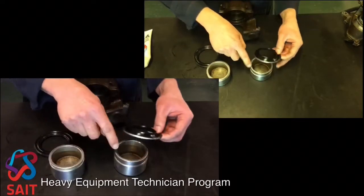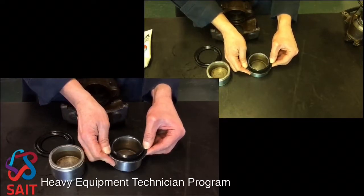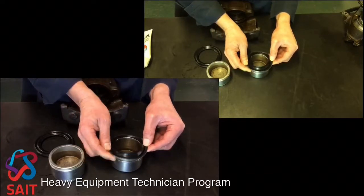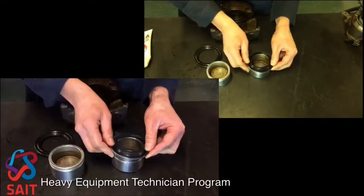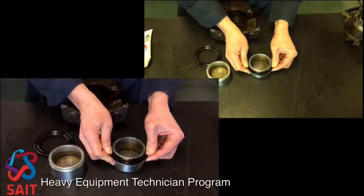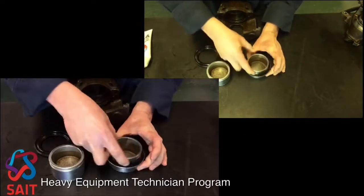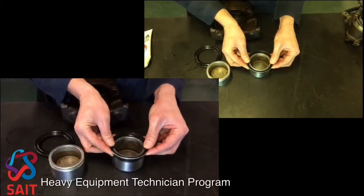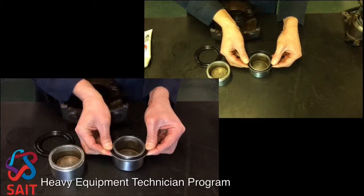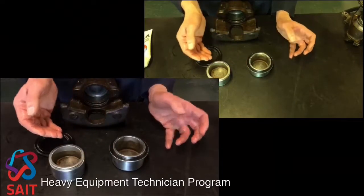When you're going to install this one, you're going to slide it down over here to start the process and make sure that the lip drops into this groove right here. I'll slide it down in there until it just drops in all the way around. Once that's dropped in, you pull this boot back — this pressed-in one — back like that, and roll it down on itself. At that point we'd be ready to install that piston into the pressed-in style caliper.